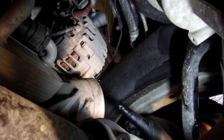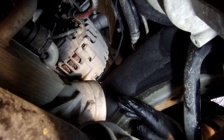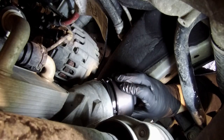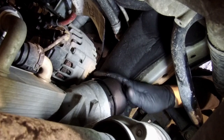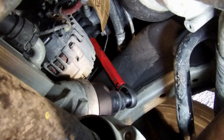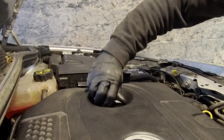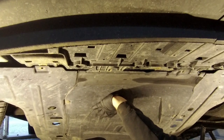Before we install the new filter, wipe with old oil — it will look much nicer. After that we can install the filter cap in place. This is how it looks from the wheel arch. Fit the filter cap in place and screw it in by hand, then tighten it with 25 Nm torque. We are ready to fill the engine with fresh oil. Engine oil capacity is 4.5 litres. Remember to dispose of the old oil responsibly. Now we can fit the bottom cover, tighten all screws and fit the plastic clips.